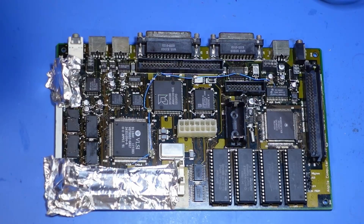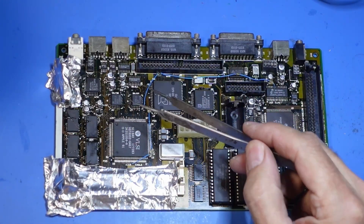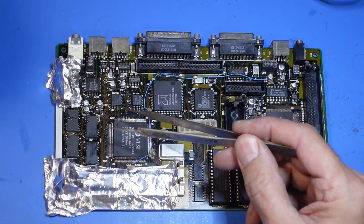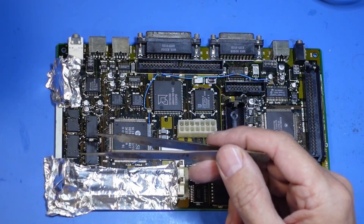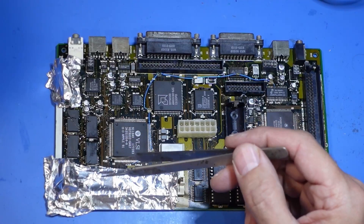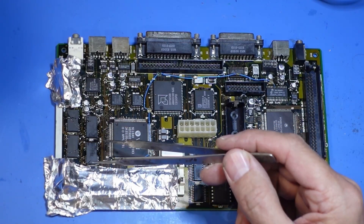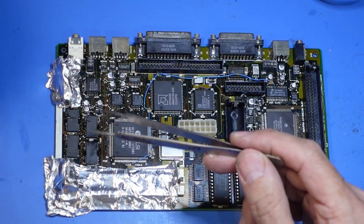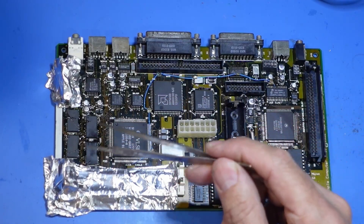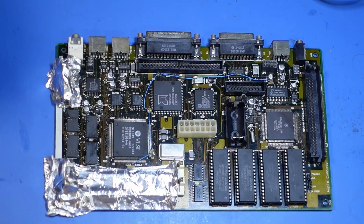It's another day and we're back on this Apple Macintosh board. Because all these capacitors are here, I reckon when they leaked they leaked underneath these memory chips. So I'm going to remove these four memory chips and scope out the tracks to check there are no broken traces, clean them up, and re-solder them to make sure there's no capacitor juice underneath. I'm seeing corruption on the screen which could be a short caused by the memory area.